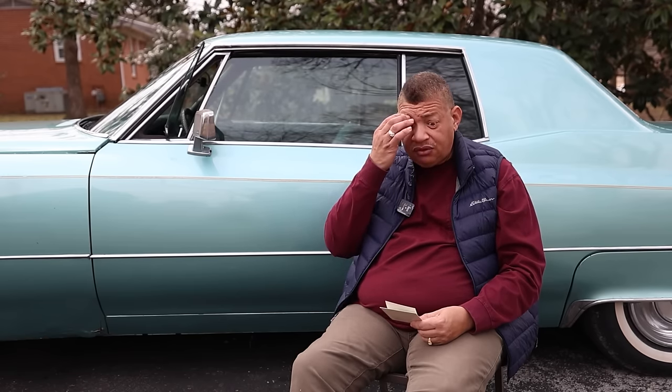Since the carburetor was off of it, I was trying to deal with the fuel line to the carburetor, since they cut the line and the original parts were still on the car. I was having issues getting that line off. So I had to take off the alternator and the smog pump, those were the two things I had to take off in order to get that fuel pump off and get a new fuel line on there.